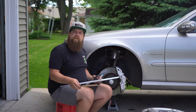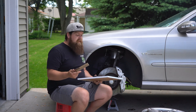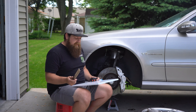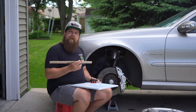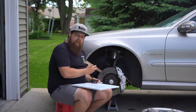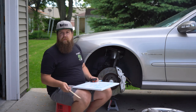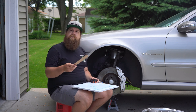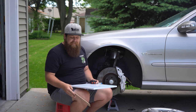A general rule of thumb is to add about 3 millimeters to that measurement to safely account for heat expansion. Adding 3 millimeters gives me 212.55 millimeters, which converts back to 8.36 inches. We multiply that by two to get the full diameter measurement: 16.72 inches. Rounding up from 16.72, the smallest diameter wheel we can fit on the front around these brakes is 17 inches.